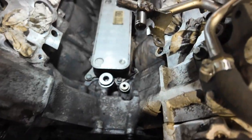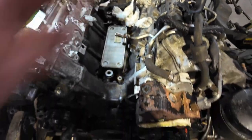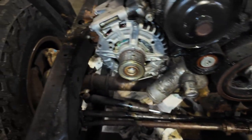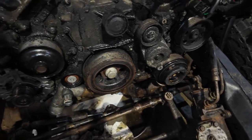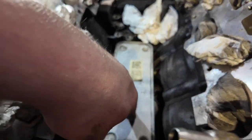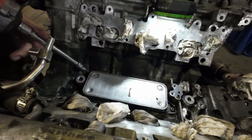Once we get the seals changed on the oil cooler I'll go ahead and put the intakes back on and seal those off, and we can work on getting the rest of the grime off the front of the engine. I really don't know if this was all from the oil cooler - I think there's another leak. But it's so caked on there it's hard to tell, so we're just going to clean everything off, do the best we can, and if we find another leak later we'll come back and fix it. This is most likely the cause, so fingers crossed that's all we have for an oil leak. Let's pull the oil cooler out.